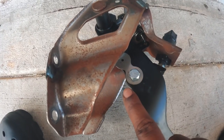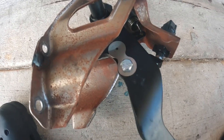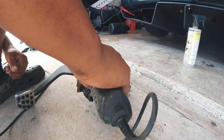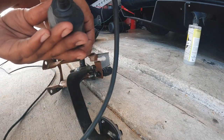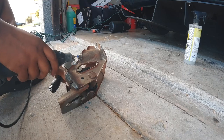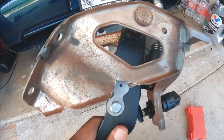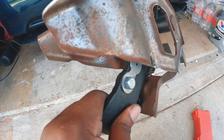As you can see, the template fits round into the pedal and that tells you exactly where you have to drill. What I'm actually going to have to do is cut out a little bit of the bracket so I can have access to drill it. As you can see there's a catch, but you just have to drill out a little piece like I did and then you have access to drill and bolt in your clevis.